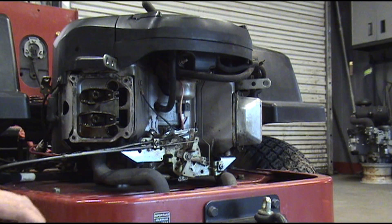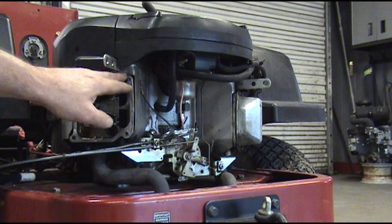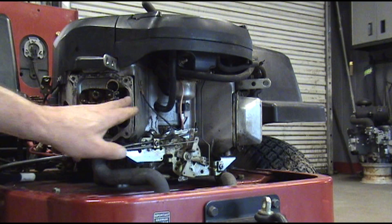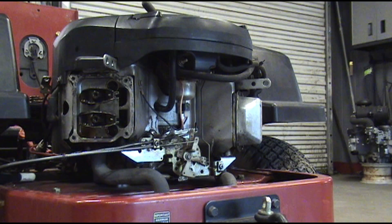When you get ready to put these valve covers back on, you want to be sure — best you can — to clean that old sealant off there. Wipe all the oil off and clean it. I usually use a little gas on a rag, come back and clean it, and let it dry before I put my sealant on there, because it needs to be dry and clean. I hope you enjoyed this video, I hope it saves you some money. Stay tuned for more repair videos. Thank you.